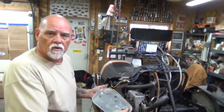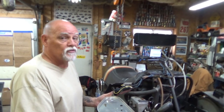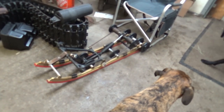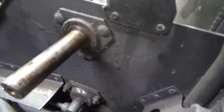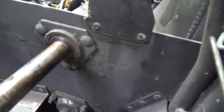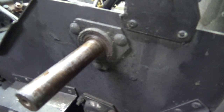We got one of the bolts that pulled the thread, so we might be looking for a chain case — we'll see. I've got chain cases. We got the skid out already too, so we'll have this thing apart in a couple more minutes. Taking stuff apart, and the bearing looks pretty gunked up. I've got to weld up a crack in the bulkhead, so we'll be doing that before she goes back together.